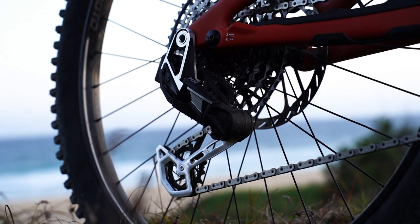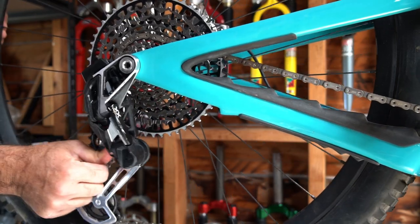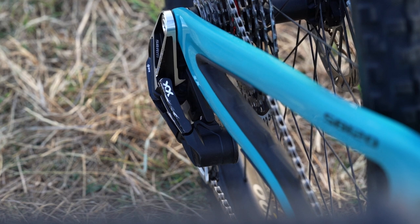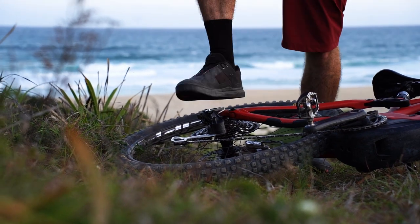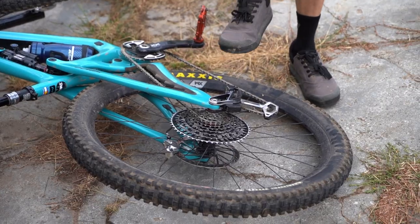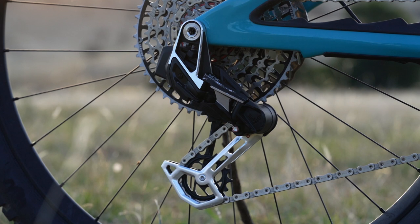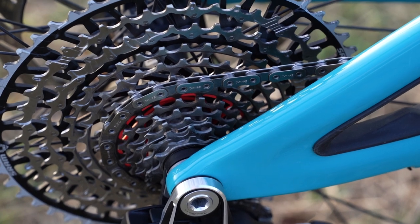After absorbing the impact, the derailleur then shifts back into its previous position. Secondly, the UDH dropout allows the derailleur to rotate backwards in the event of a frontal impact. Finally, and perhaps most importantly, the derailleur's direct mount design means that lateral forces are directed into the axle rather than the frame. After hearing from SRAM about how strong the new derailleur design is, we decided to put those claims to the test by laying the bike on the ground and literally standing on top of the derailleur. Aside from the sickening sound of the overload clutch giving way, the derailleur actually feels uncannily solid underfoot — more of a structural member rather than a delicate mechanism hanging from a small piece of alloy. Having repeated this torturous show to many riders over the past six months, we're still yet to inflict any damage to either the frame or the derailleur.